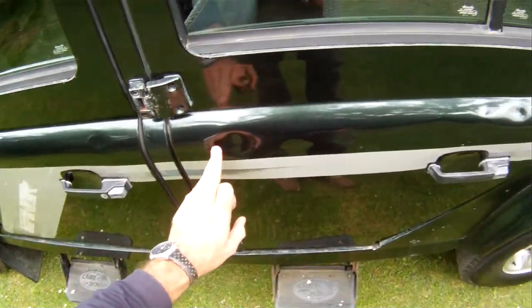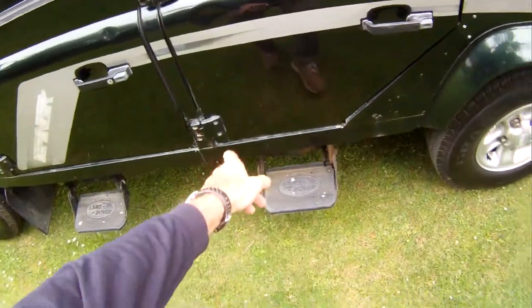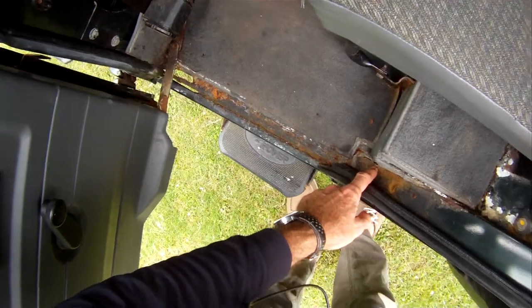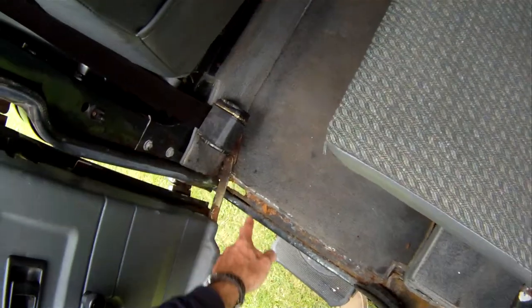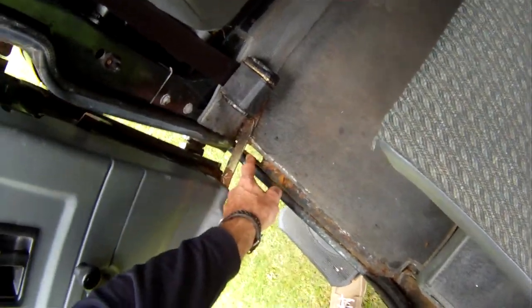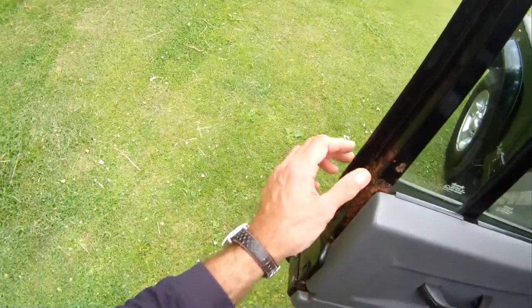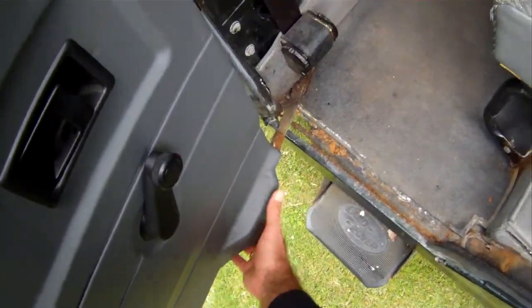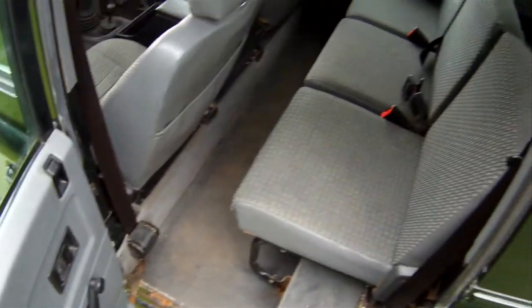In the near side rear door there are quite a few depressions in the barrel side — one there, one there, one there, and one there. There's a bit of reaction on the bottom edge and down there as well. Inside on the near side there's a tiny hole in the bottom of the D-post, and a little hole in the sill in the side frame piece. The bottom of the frame is a bit corroded but as I say not in imminent need of repair or replacement — it still shuts nicely.